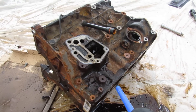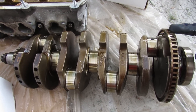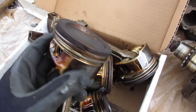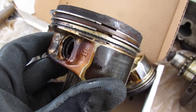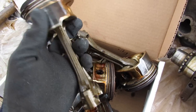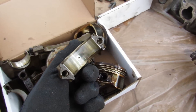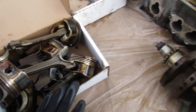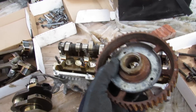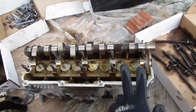My only wish is that they made this thing out of aluminum instead of iron, especially being an economy engine. The crankshaft is pretty straightforward for a 4-cylinder engine, with the only exception being this reluctor ring that picks up signals from the crank position sensor so the engine knows its RPM. Overall, the oil control rings on the pistons don't look completely clogged up, so I don't think this engine was burning a lot of oil. There is a lot of crust on top, which is normal for any high-mileage engine. This engine looks fairly well lubricated — there's oil on every surface and no extra wear. Most of the simplicity in this engine comes from the timing belt instead of a timing chain, no variable valve timing, a single overhead camshaft, and only 8 valves total — 2 per cylinder.